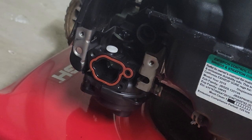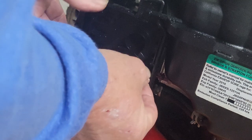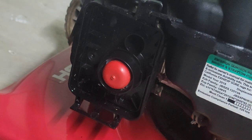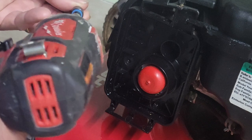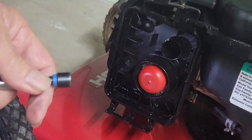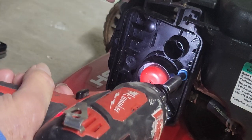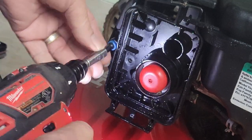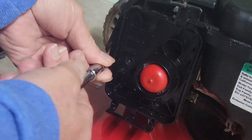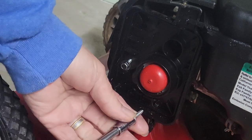Let's put our air box back on — it should go right here. And don't over-tighten the bolts when you do this, because if you tighten up so much that this plastic warps, then you'll lose your seal and your primer won't work. These are the ones you worry about the most, the truss screw-looking ones — those are the ones that can really wreck your prime.